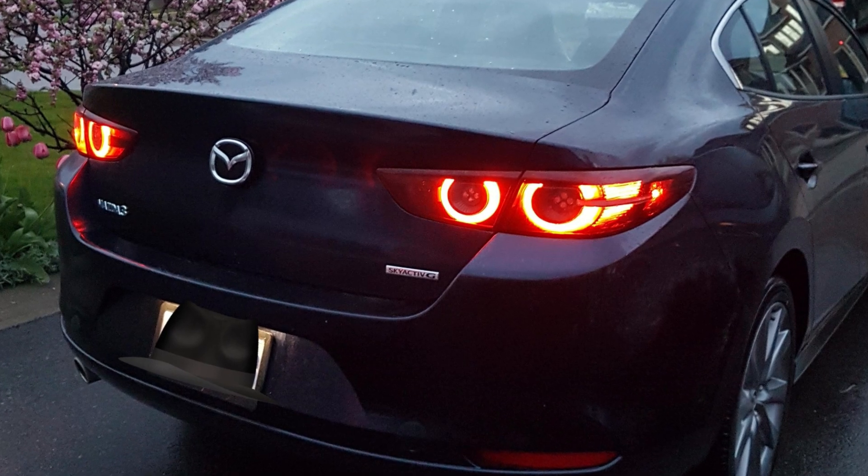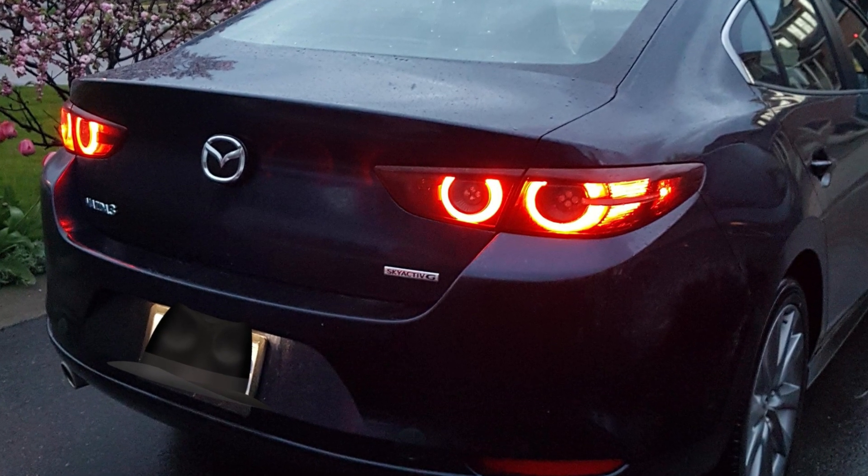There is one simple trick to check the brake switch before buying a replacement. Press the brake pedal and the brake lights should light up. If you press the pedal and the brake lights come on, the brake switch is okay. If you press the pedal and nothing happens, the brake switch may be faulty — or the battery could be completely dead with no power to light up the brake lights at all.